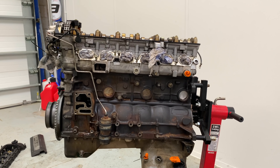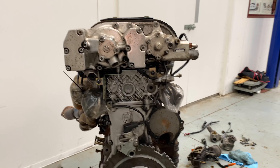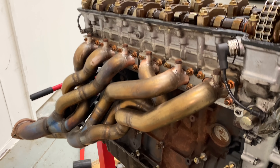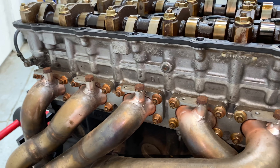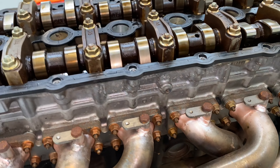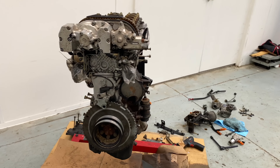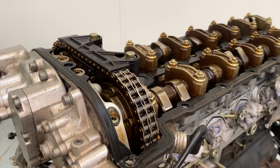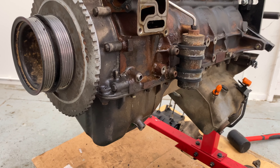It will be stripped down further. Obviously, I'm going to do the head gasket and things like that. I'm just trying to decide how far to go with it. Got those Super Sprint manifolds — I haven't taken those off yet because they're effectively sealing up the exhaust side, so that's not a problem. I know things like the Vanos are being done. I'm going to replace the cam chains, the guides, and the tensioners. The oil pump I'm also going to change out for a new one.